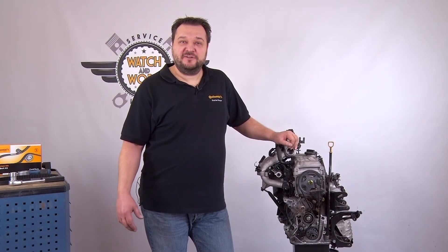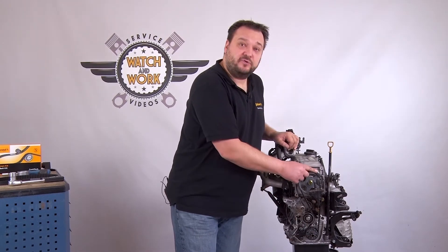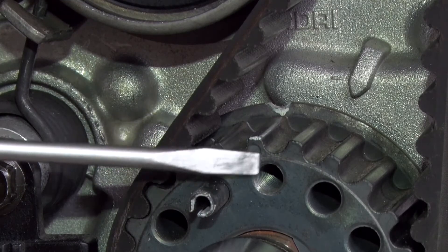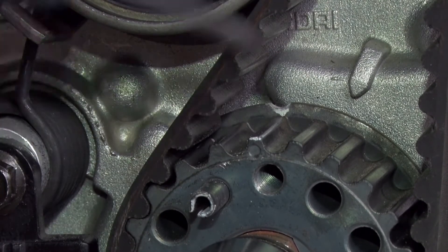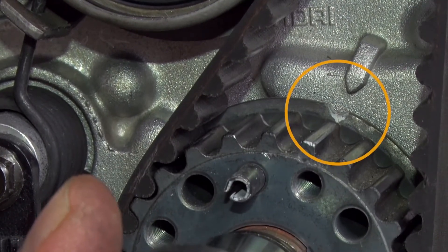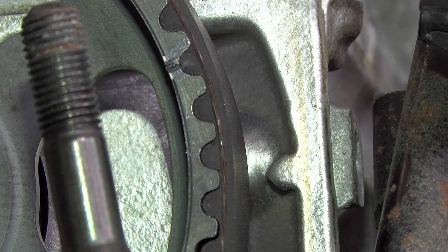As with almost all of our engines, the timings have to be set. Once again we have two marks that have to be adjusted: one on the crankshaft, a special mark, and one on our camshaft sprocket. On the crankshaft sprocket you'll find a tooth with a recess on it and another recess behind it. The two marks have to be aligned with the lug at the start. On the camshaft sprocket you can see a notch. This has to be aligned with the lug at the back.